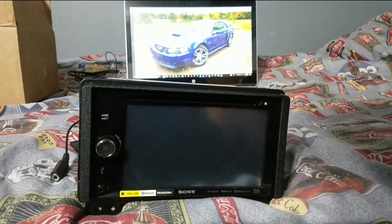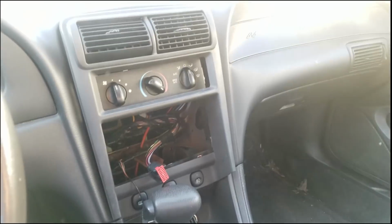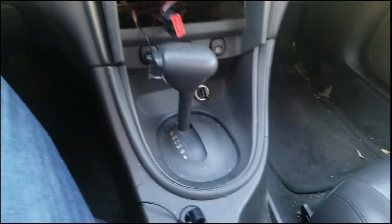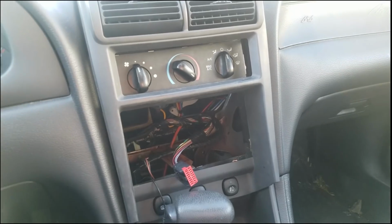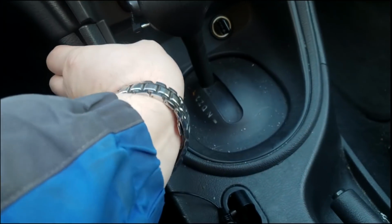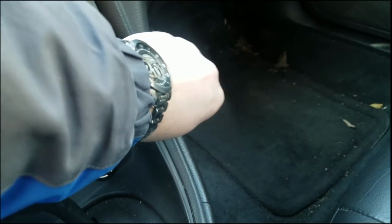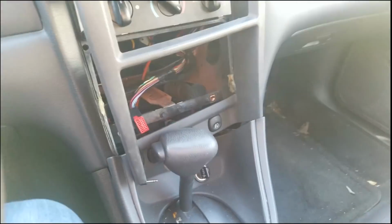And now, back outside for the installation. Alright guys, so what you're going to need to do to take out this center console in order to get access to put the good old stereo system in is to take this piece and this piece out. I had already taken the liberty of getting rid of the stock head unit, so we just gotta get the clips on both sides taken out. Alright, we got the first piece taken out. The second one, there's some clips you need to plop out, but it just kind of sits like that.